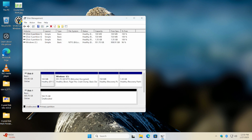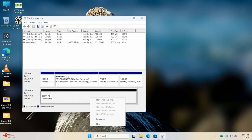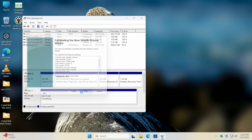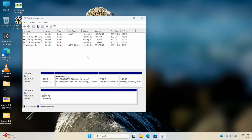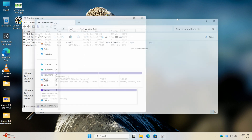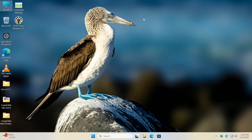Since there's nothing we want on the drive anyway, click OK. It shows the drive as a 500 GB unallocated disk with no partitions. Right-click and select 'New Simple Volume,' then Next, Next, Next, Next, Finish. That's it — the drive is completely reset, and once formatting completes, we essentially have a big flash drive we can use, or plug internally if we want.